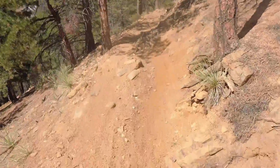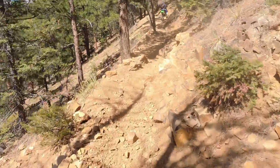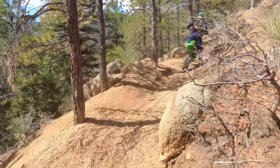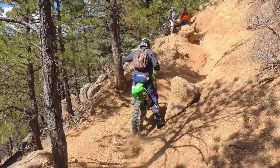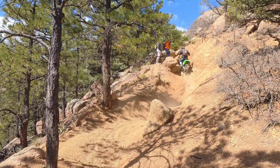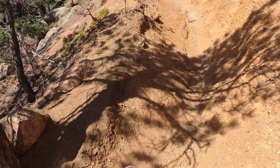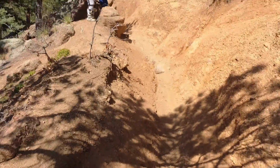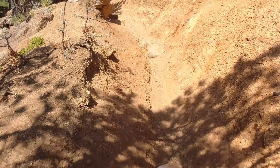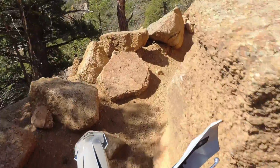Another cool feature is that this is a 6-speed transmission, so you don't see a lot of that. Oftentimes these cheaper bikes like the XT250 and such are still using a 5-speed transmission. So I find that the transmission on this bike is pretty phenomenal, even in its stock configuration. The grunt down low and overall gearing stock, I think I'm going to leave it this way. I can't see lowering the gearing anymore because I feel like I'd lose a lot of capability if people want to ride on the street at all.